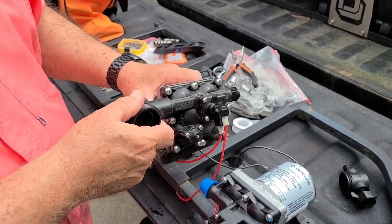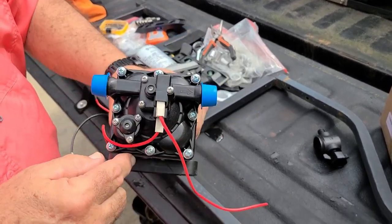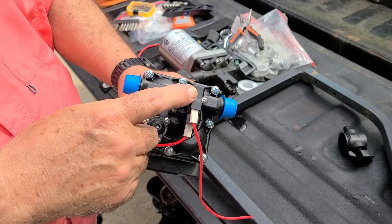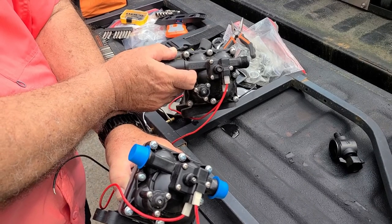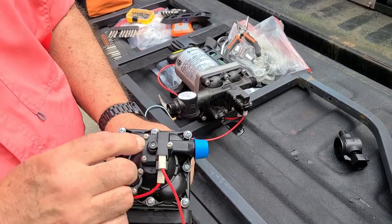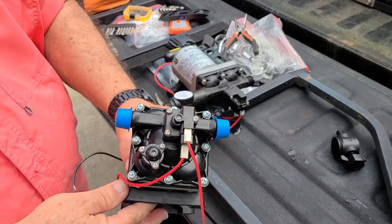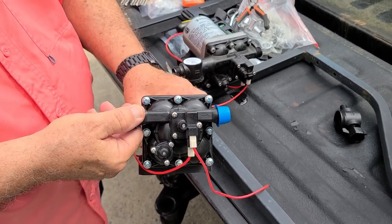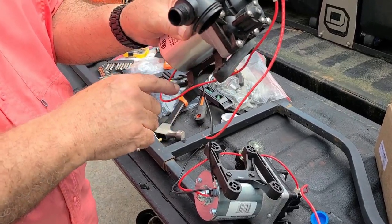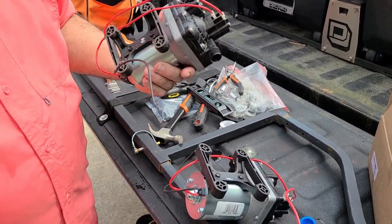The old filter is here. On this new motor it's got the same circuit and the switch is here. This is the little 9/64ths Allen wrench you use to adjust it. When we turned it a quarter turn counterclockwise, it should have turned the motor off but it didn't — something's wrong with this switch. I can probably get in there and fix it by just taking these screws out, and I'll keep it as a spare. This new motor is essentially the same as the other one — I'll put a link below to where I got it on Amazon. It has the four legs just like the other one, except the manufacturer ran the screws through the rubber instead of through the holes. It only takes a few seconds longer to do it right.